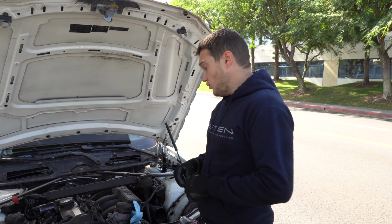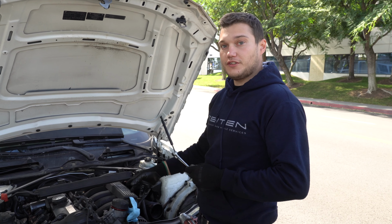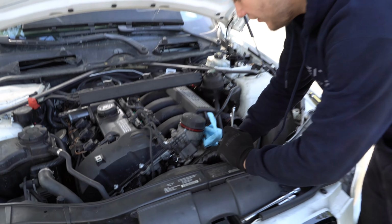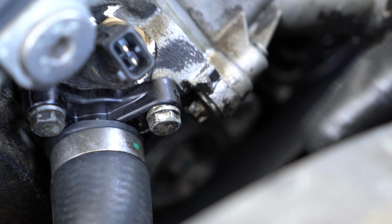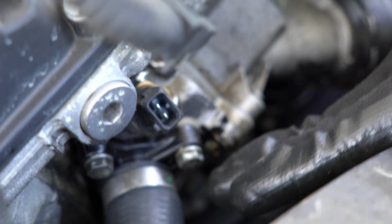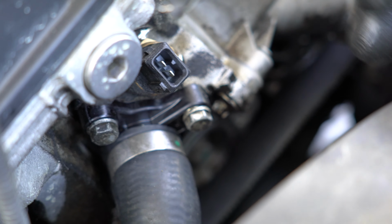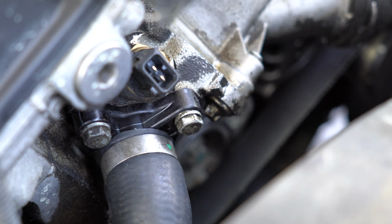The next thing we're gonna do is remove one of the hardest bolts on the oil filter housing. There are only 3 bolts in there, and this is the one right there. It's facing towards this hose. It's a coolant hose from the cylinder head to the thermostat, and on most cars, like we just replaced this one, but I'm still not gonna remove it. On most cars, when you remove this hose, it just breaks, so you'll have to replace it. I'll show you how to remove this bolt without touching this hose.